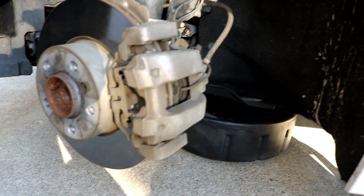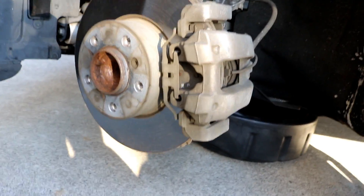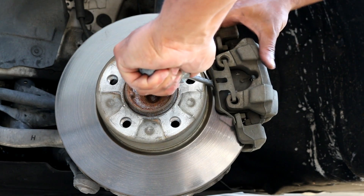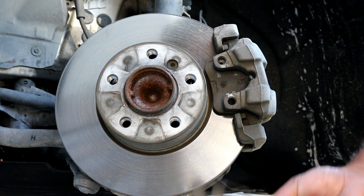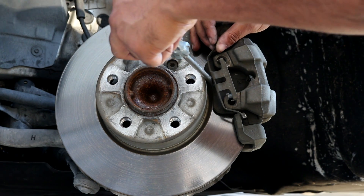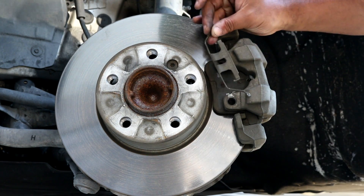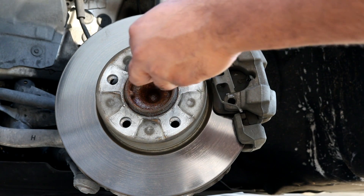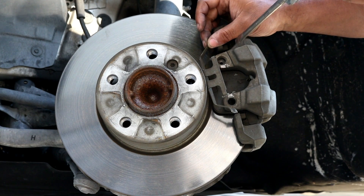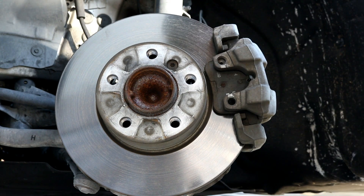The first thing you want to do is get the spring off. You can just use a flathead screwdriver to get this retaining spring off the front. Pretty much the spring needs to go towards the back of the car — pry against the rotor and the spring will just pop out. Be careful that it doesn't fly up into your eyes. If it's still not wanting to come off, grab a second flathead screwdriver and use a small one to stick it right inside the hole to pry it out, but usually it just comes out just like that.